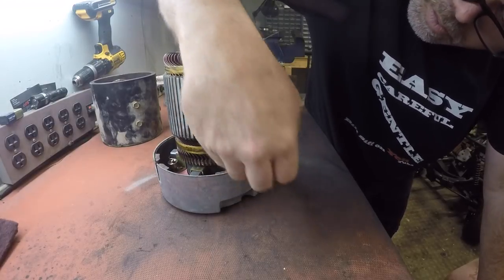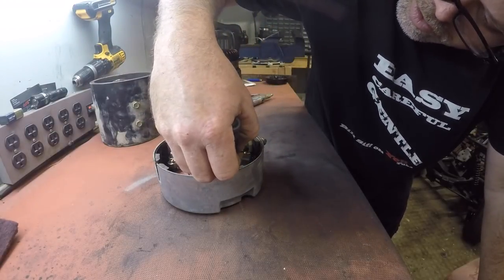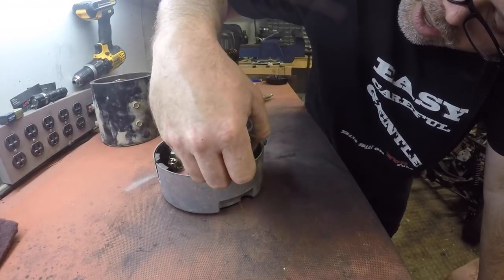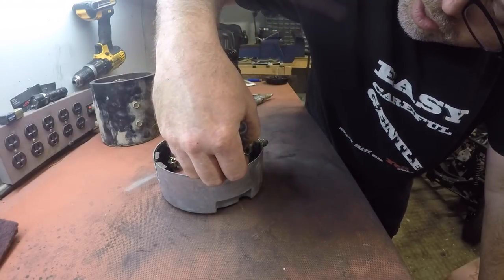Need something smaller — that ain't working. Let's try this little screwdriver. There we go, that's better. So I just want to go through this like this to make sure there's no metal caught in between these lines, because that could be causing a short too. I don't know if this is true or not but I'm going to try it — nothing to lose when you already got a dead motor.